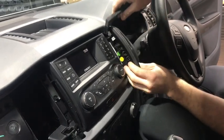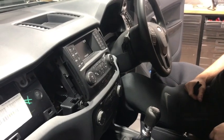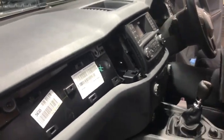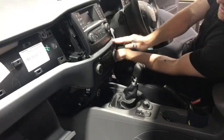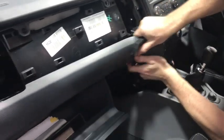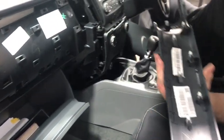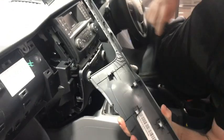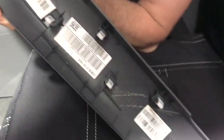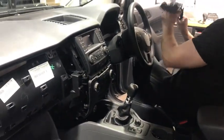Just a little bit of levering and you can get all those air vents off — that's the first step. This last plastic panel across the top will just clip off as well; you're really just pulling it forward and it's off. With these panels, if you have any little white clips that are missing or stay on the car, make sure you pick them up and put them back on, because they hold all your panelling.